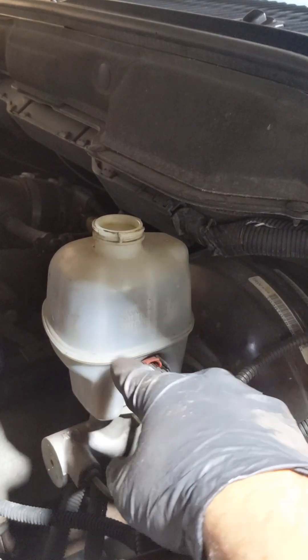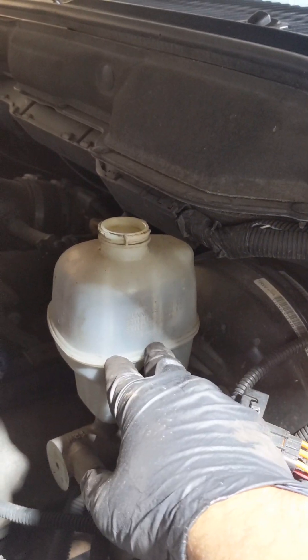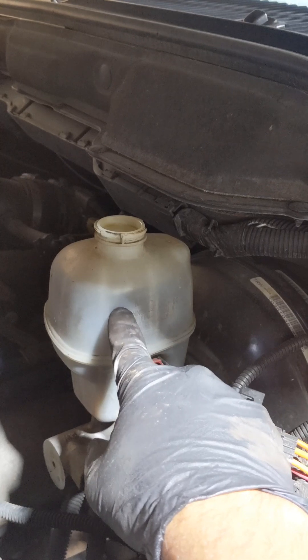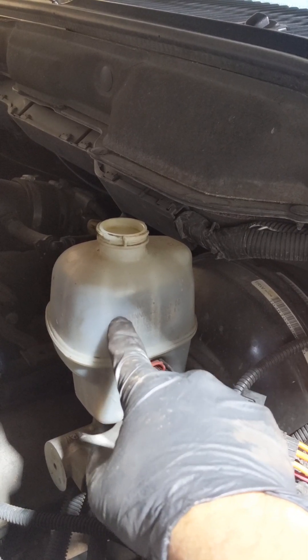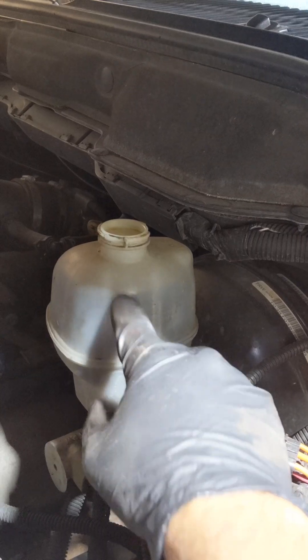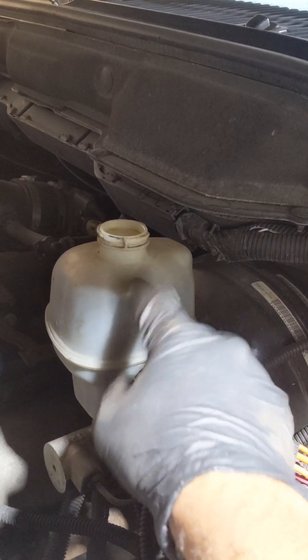That's one way to detect how bad your brake pads are if you can't look at them. Do not add brake fluid. When it comes to being a quart low, this is the time you should replace your brake pads. After you replace the brake pads and press all four calipers back in and install new brake pads, this fluid will come back to the recommended level — that is guaranteed.